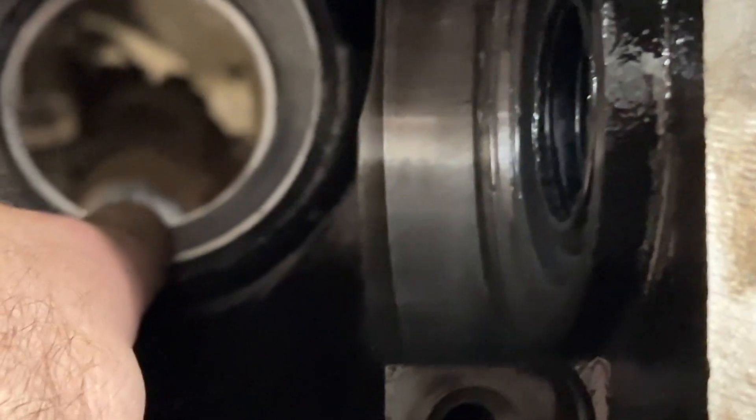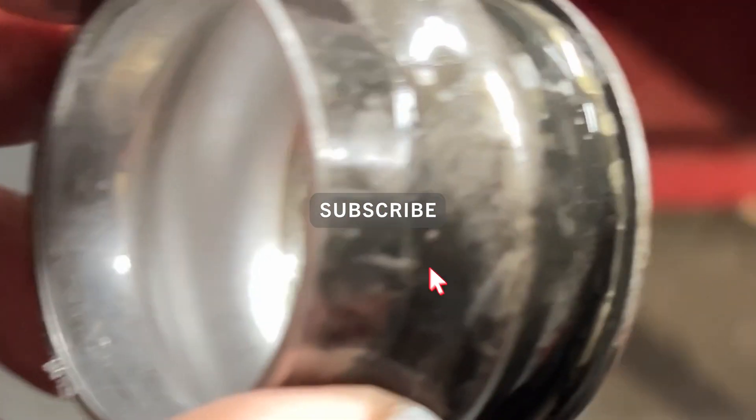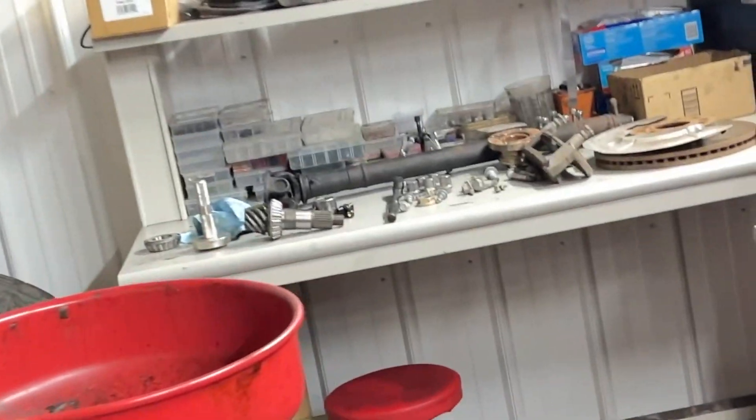Before you go back into the diff, you've got to press this bearing onto the bottom. I had one shim and the shim goes right behind the race. I just put the same one back — I think that'll be pretty close, it was just fine on the back. This is the old crush sleeve and it just fell off, which is kind of funny because the back one I had to actually force off. We're definitely getting closer. I'm going to set the pinion now, put it in, do a couple of test fits, make sure everything's good, then put our gasket in and we are pretty good to go.